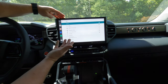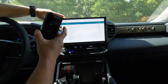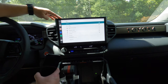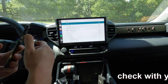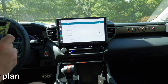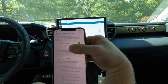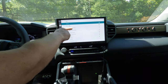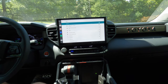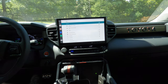I connected it to my home Wi-Fi — I'm never really going to need this at home, but just in case I put it in there and it will save it going forward. What I really had to do was connect it to my mobile Wi-Fi hotspot from my phone so that if I'm away from home, on the go, stopped somewhere, eating lunch in the truck, I had to set it up to connect to my phone. In order to do that, all you're going to do is come into your iPhone settings. There's an option that says Personal Hotspot. Click on that and make sure that green slider is turned on where it says Allow Others to Join. Once you do that, Judge's iPhone 12 Pro Max shows up as an option to connect to. The first time you will have to enter the password, which is listed on your phone.